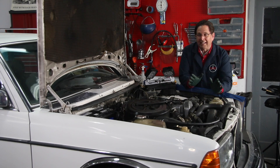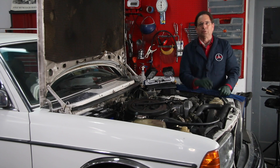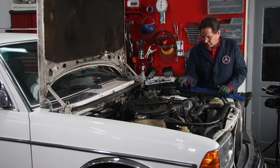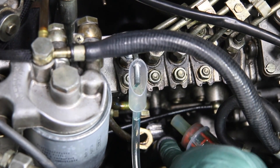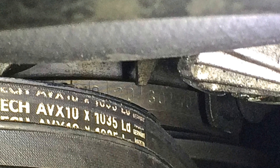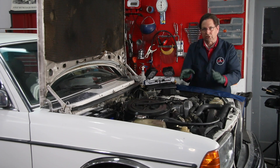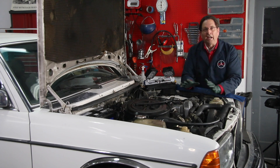With the high pressure method, you can go ahead and adjust the pump without stopping to pump or having a friend pump. I use the flow method when I'm just checking injection pump timing, as is the case with this 300 TD wagon — it's smoking out the exhaust and I want to find out if the timing is on or off. I hooked up my little container, hose, and bottle to catch the drips, got a helper under the car to rotate the engine, and determined that the injection pump timing is okay on this engine.